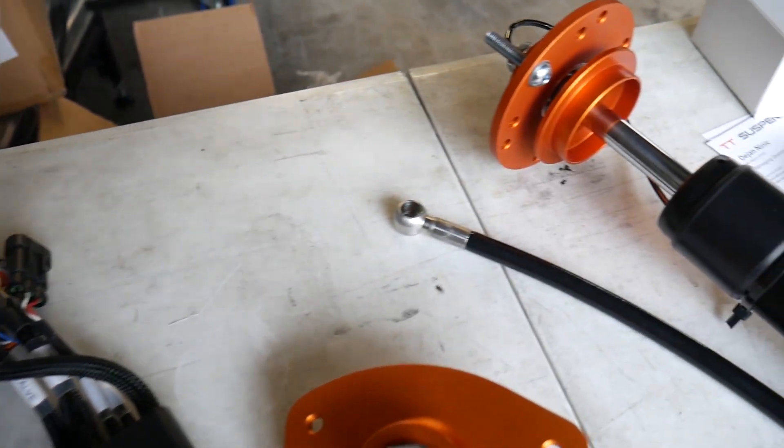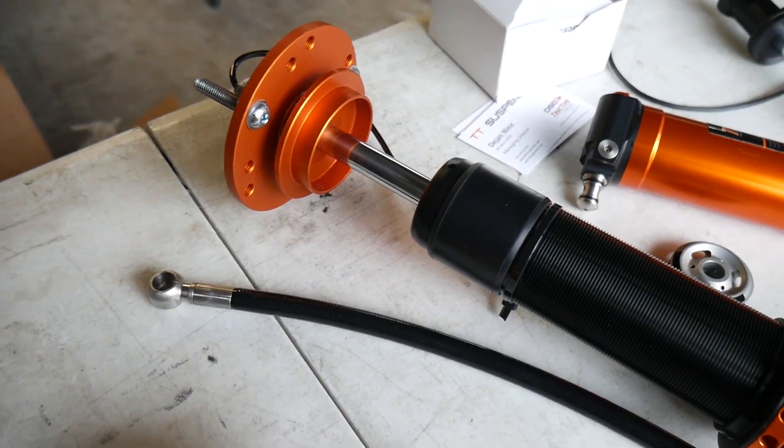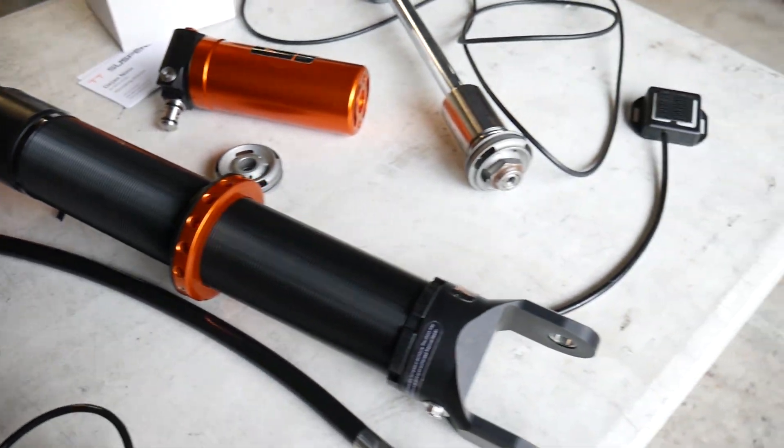Is there any more scope for doing this as an active spring rate as well for each wheel? We're already quite progressive because we have a stiff spring feeding into a stack of bump rubbers. But the fact that the damping resistance can also be made as a function of suspension position means we are effectively changing our spring rate, because our force versus deflection varies.